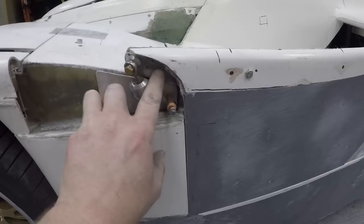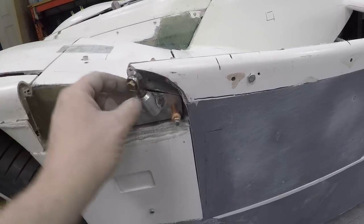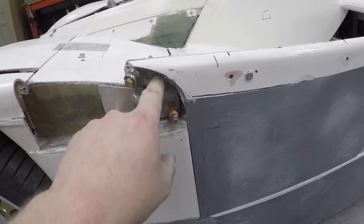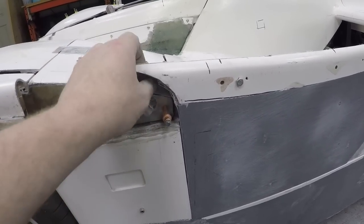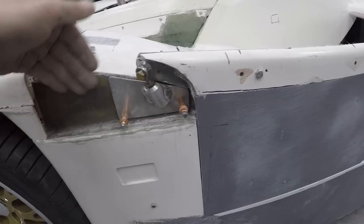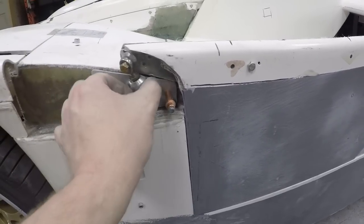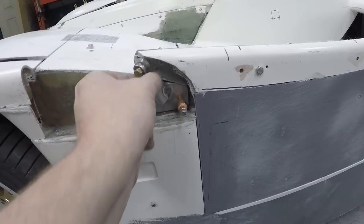The top plate is what came with the body — basically a small turned aluminium piece with a quarter-inch UNF thread. It's temporarily riveted to the back skin but will eventually use some structural epoxy and be matted inside with fiberglass. The bottom pivot was a little different because this vertical is further in now than before since I've moved everything out, giving me a nice big weld onto there — a nice bit of three-mil plate.